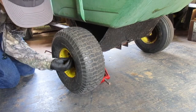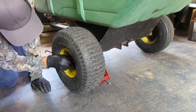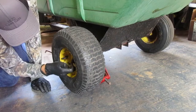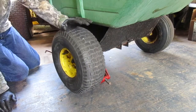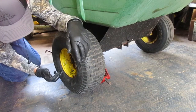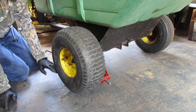I don't really have much work for it this week — it's gonna be sitting, so I won't be doing any hauling or anything with it. This rim here is getting a little crusty. It's just really old, and here on the inside it's really rusting out. For a while it ran on fix-a-flat — I think some was put in it at one time — and then it had an inner tube put in it. But you guys can see it's got slashes, it's starting to crack real bad, and even though it has an inner tube in it, I don't trust this rubber. I don't really trust dry-rotted tires like this.